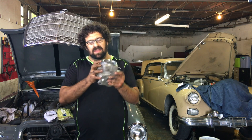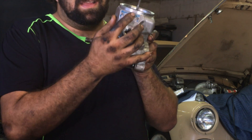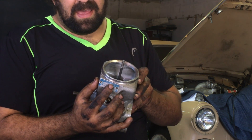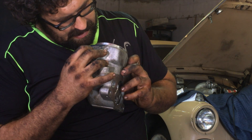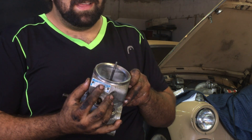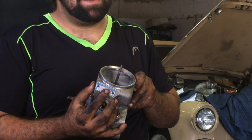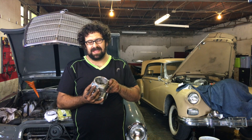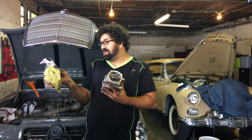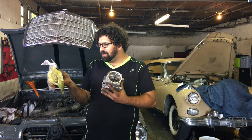When buying your kit you also need to know what power steering pump you have — it's going to be right here on this tag. This is a pump from ZF, which stands for Zahnradfabrik Friedrichshafen. There's also one from Vickers Sperry, and they both have different rebuild kits. The Mercedes part number for this seal kit is 000-586-84-46.